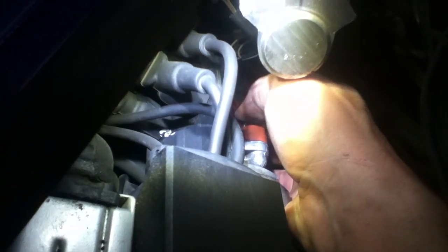Just like an E30, an M20. So we're going to pop these little covers off if we can. I see this one's been tampered with actually already. You can see that little bite mark in there. You can actually adjust the timing of both banks. Isn't that interesting? So we're going to pop this off and have a gander. Well, I got the little back cap off this little assembly. Just undoing the screws now. There's two screws that hold each cap on. 8 mil. And each distributor controls one bank.